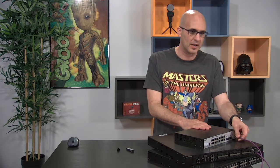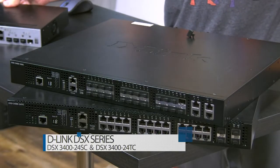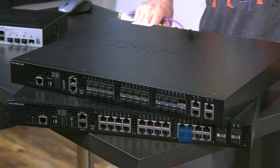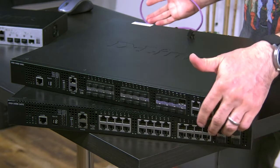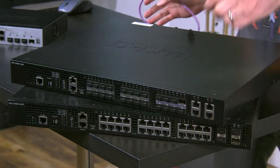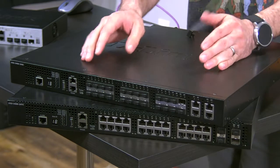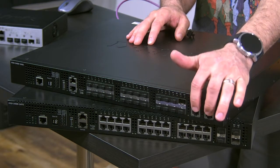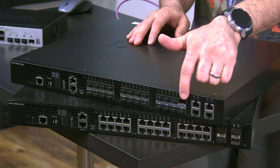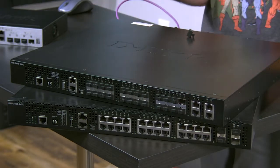Let's take the DGS out of the mix for a minute and talk about the DXS series. We've got two switches that are nearly identical — they have the same number of ports, but the port types are different. The one on the bottom has all copper ports with a couple of 10 gig SFPs, and the one above it is all SFPs with a couple copper on the end. These are both 24-port switches — if you count the front holes there are 28, but minus the console ports, you've got 24 active ports plus four that negotiate between copper and SFP on the same port number.